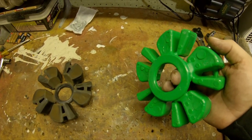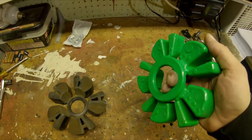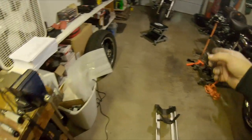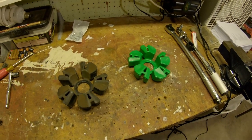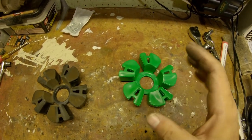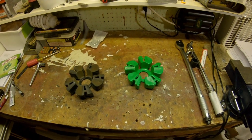According to my mechanic, these rubber stock cush drives should be swapped about every 5,000 miles or every time you swap tires. He said if you can grab your rotor while it's on the bike and give it a shake and there's movement, your cush drive is tired. The new Super Cush one should last about 15 to 20,000 miles before it needs replacing — and for $40 on Dennis Kirk's website, why the hell not? The belt spins the pulley, which twists the cush drive, which in turn spins the rear wheel — it cushions that torque translating power from the transmission through the belt to the rear wheel.